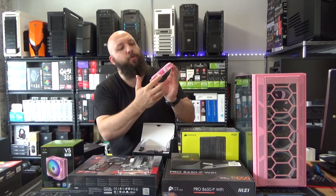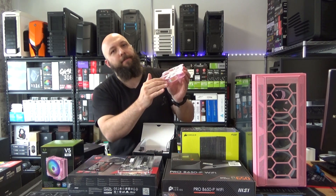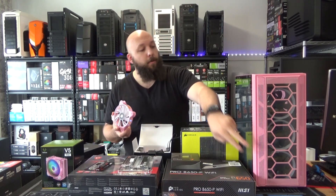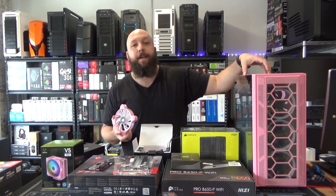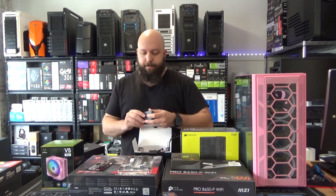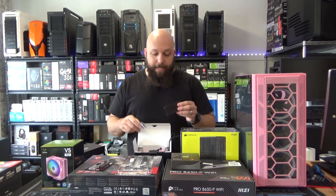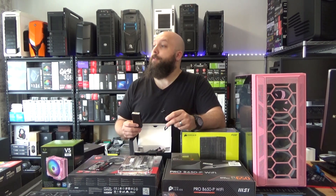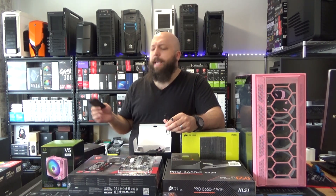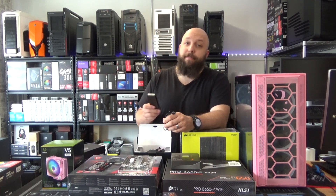There's not actual light tracks that run through, but there is this sparkly film over the slats, so the RGB light from the fan can actually shine through. I've never seen that on a fan before. We do have six of these — we're going to replace the three fans up front, add two fans on top, and replace the exhaust fan. So for airflow it's going to be three intake, three exhaust. Something to note about these fan kits: they come with a 10 fan hub, so with six you're barely halfway there. This hub can be connected either via remote or directly to your motherboard — great if you're using an older motherboard that doesn't have those headers, or maybe you just have some damaged headers. I've been using Asia Horse fans more and more in my builds. They're fairly practical, good looking, and come in at a great price point — no complaints yet, but if I ever do, I'll let you know.